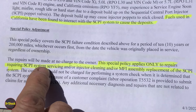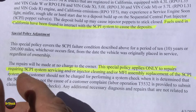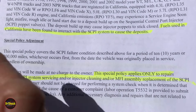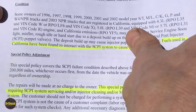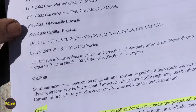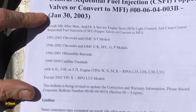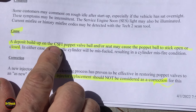The policy would cover cleaning these injectors of the SCPI or CSFI — GM used two different acronyms — or ultimately, if it was particularly problematic, they would upgrade you to the MFI system, which is the system that came after CSFI and replaced it. If you weren't in California, there was another bulletin covering everybody else with federal emissions, also released the same year, and again the problem was deposit buildups — basically carbon. Here they're using the CSFI acronym.